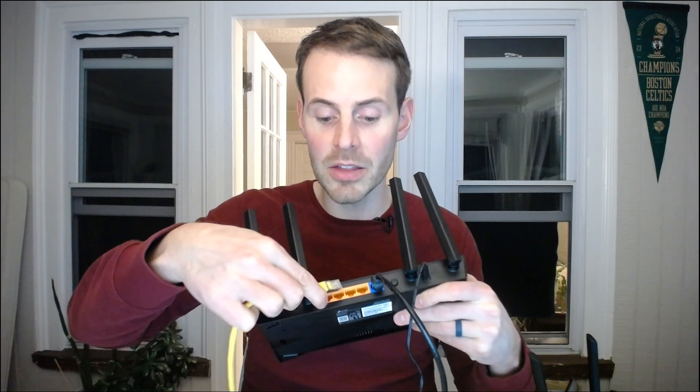The next thing we want to do is connect our new router to our wireless access point — our old router. In order to do that, we need an ethernet cable. We're basically taking any of the LAN ports in the back of your new router, plug one end of the ethernet cord there, and the other end — remember, with this old router in access point mode, it's looking for another device to provide it with network information, so it's looking to connect to a primary router. We connect the other end of this ethernet cable into the WAN port — this blue port here, the WAN port of the old router.